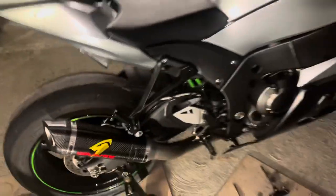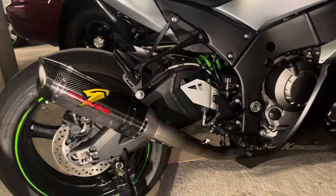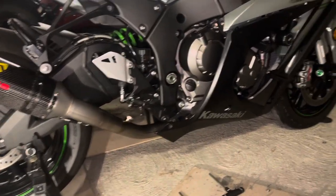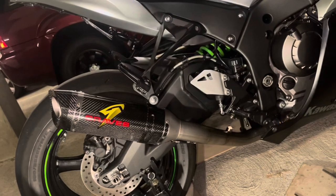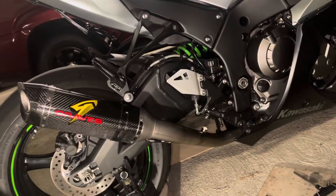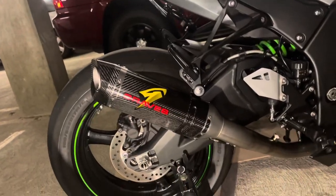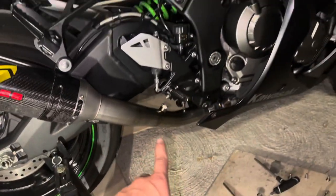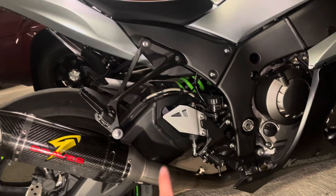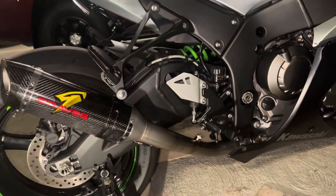Alright fellas, this is what it is — it took a little bit of time, but here's our Graves exhaust full titanium, going all the way back. That spring took me a little bit to put in but I accomplished it. Make sure you always wipe down after you install any kind of exhaust or full system — your fingerprints, once it gets hot, will stay there for the rest of the exhaust's life. So clean it up before you run the bike.